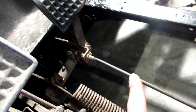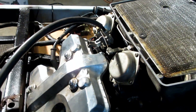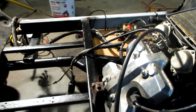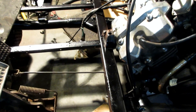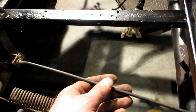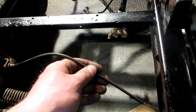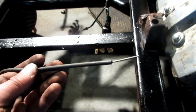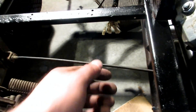I changed my mind on what I was going to do. This carburetor used two throttle cables for feedback on the motorcycle. Instead, I took the throttle cable that was on the golf cart — which is what this end of cable was — chopped it down nice and short, peeled back some of the coating so just the cable is hanging out there. Now I just have to crimp it together.